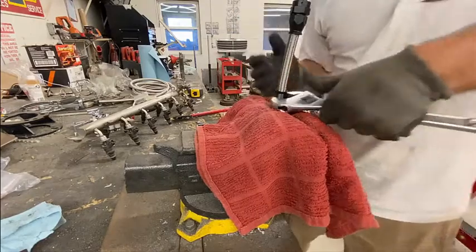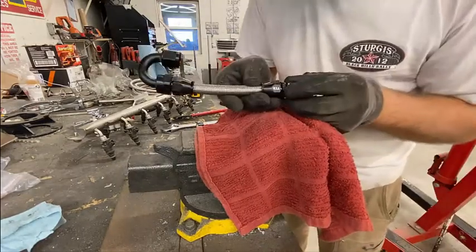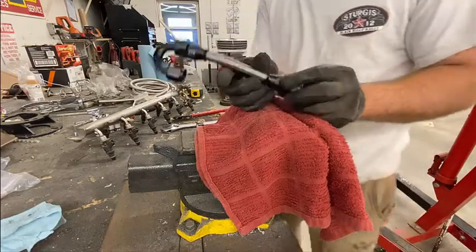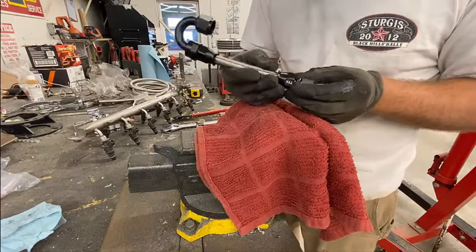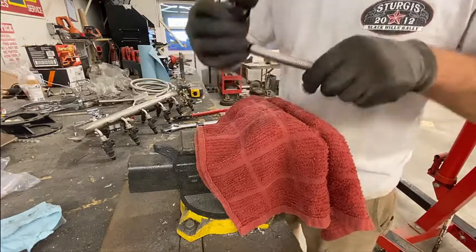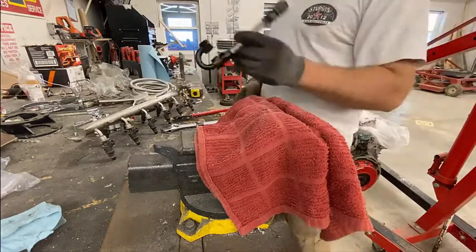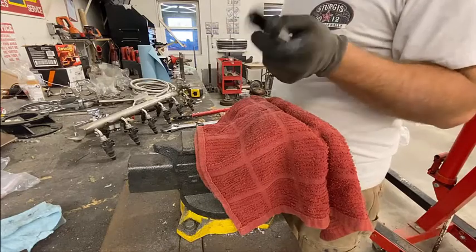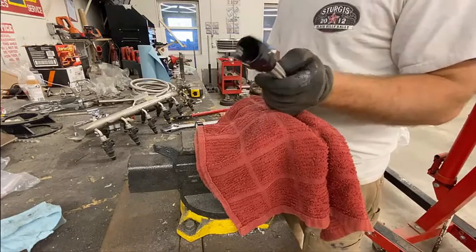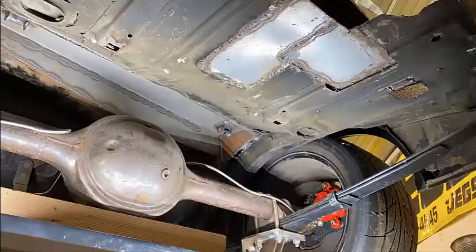There it is. All right. So, once you have it seated, you can see now, I even marred it a little bit. Kyle, where's my AN wrenches, man, that you had? I know they're in the back of your car. So here you can see it's seated completely up against this stop. Everything's good, tight, ready to rock. You have yourself a nice AN fitting piece. So we will put this on, like you're seeing, on the tank to the pump. Then we gotta pull the tank, gotta drill the holes for the pump mount, and we'll keep going.